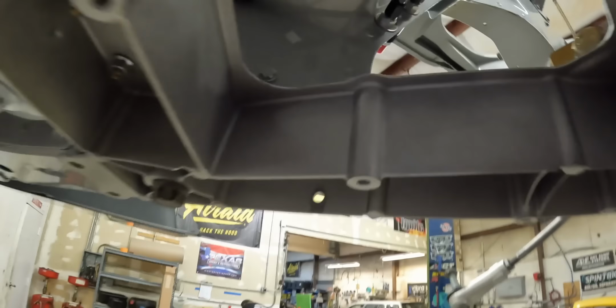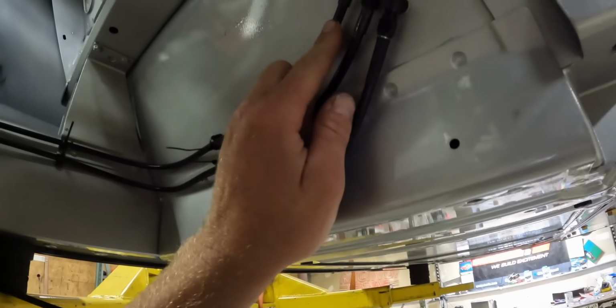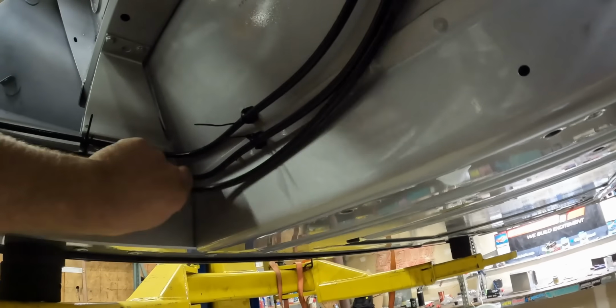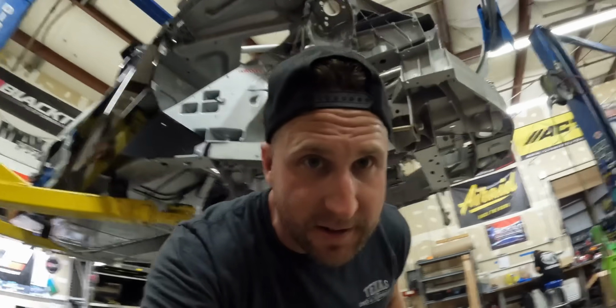Rear brake lines all the way out to the bulkheads. Pretty much done. I think I showed you guys that last time, how I ran these over to the quick disconnects over here, out at the wheel. Those are pretty much done, just needed final snugging, tightening, all that, insulating. But what we have here is the foot brake, handbrake, and the clutch line. And I need to run the clutch line over and put a quick disconnect somewhere in the back.